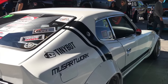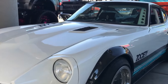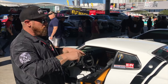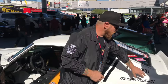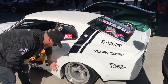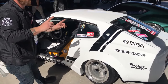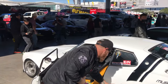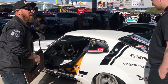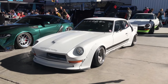As we moved along, we got the body work done and got the body kit sent from Japan. I had to convert a coupe kit into a 2+2 kit, so on all of Oscar's cars and Jeff's cars, the rear end is narrower. I had to widen all this out and then body work everything because I have an extra foot. This piece is supposed to be on this door, so I had to mold everything together — it took like three to four months to get it all molded together.